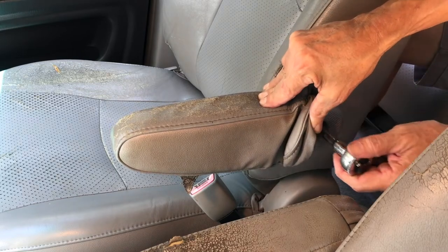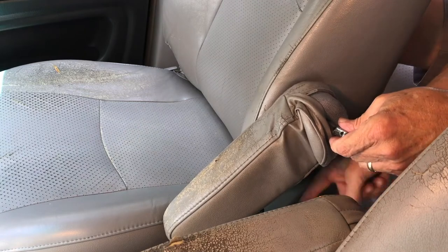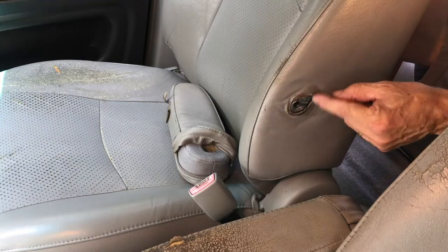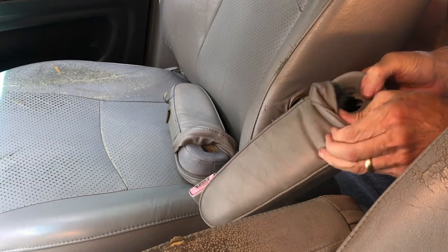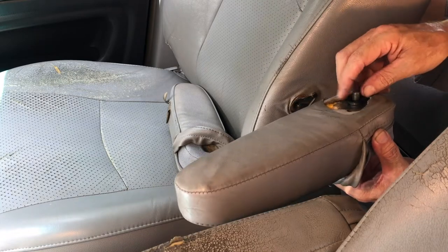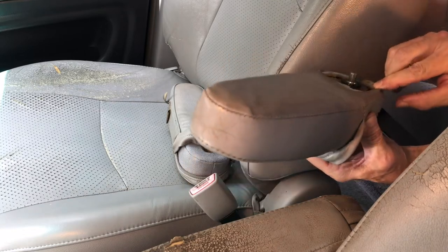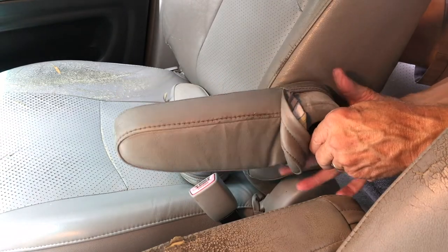You need either a deep-set socket or a short extension to get to that bolt because it's in there kind of deep. There's a plastic washer on the backside and that plastic washer can fall down in between the seat and the center console. On the inside there should be two metal washers, and here's the pin that fits into the groove — that pin being in that groove is what stops your armrest. Peel back your cover, put the bolt through the hole, and make sure you have the plastic washer on the backside with the flat side facing the seat. You may have to fold that cover out of the way so the pin can fit into that slot. See how it's stopping? That means the pin is in that slot.